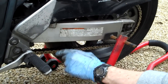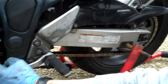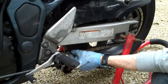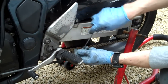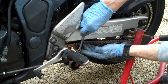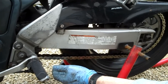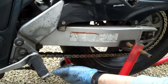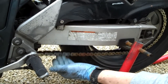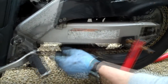One and a half inches of up-and-down movement from bottom to top at the midpoint between sprockets. Get a tape measure if you want to be really accurate. Chains get weak spots — loose spots and tight spots. You'll see a huge loose spot as you go around, and then come round to the tightest point. Always adjust chains at their tightest point. Also, this bike is on a paddock stand — you should adjust your chain with the bike upright with the weight on it. If it's on a main stand with the back tyre off the ground, it's going to be falsely loose.